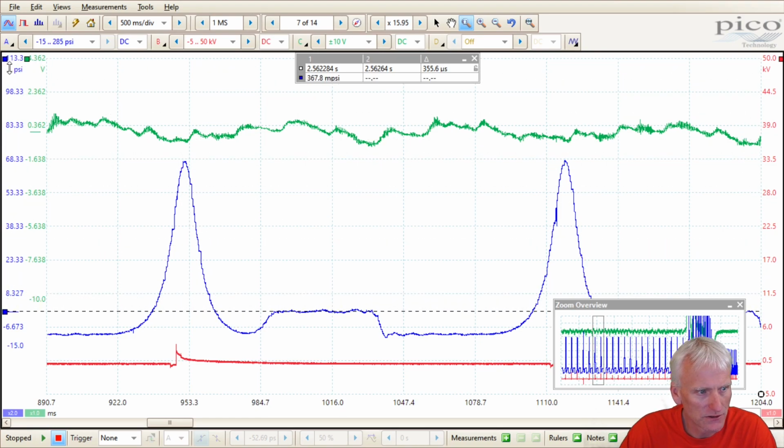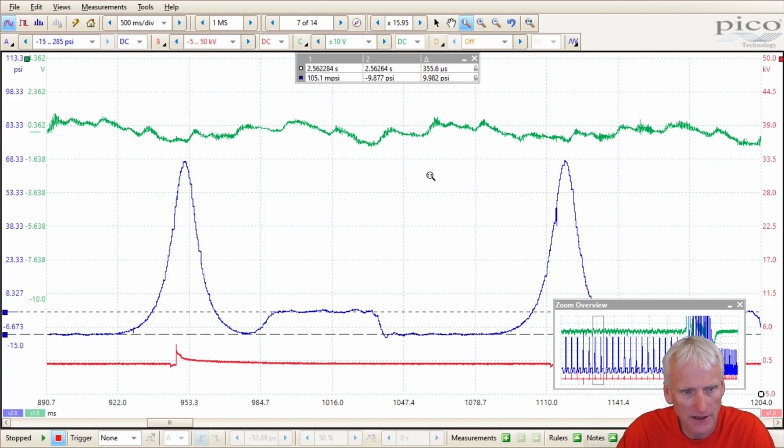I look at my pressures. I've got 67 psi compression, and my intake pressure is like negative 10 psi. I'm running at pretty much 0 for my exhaust. There's a tenth of a psi. So far all of these sensors have done a good job measuring intake vacuum.